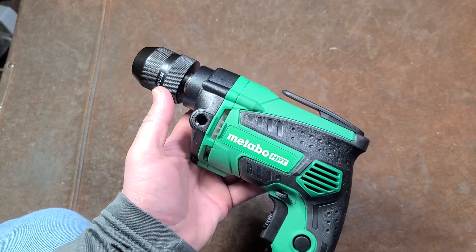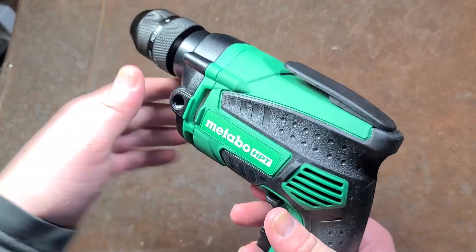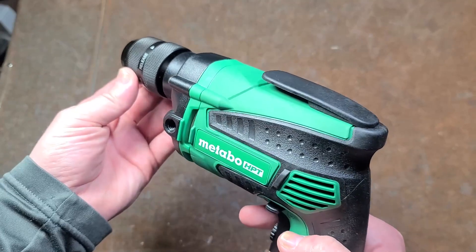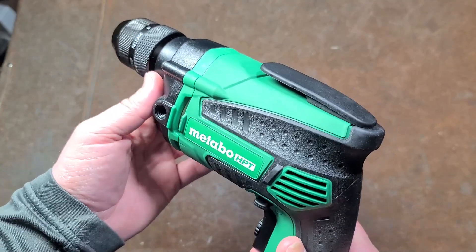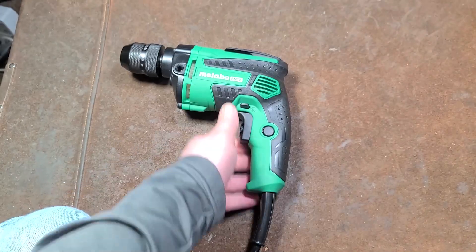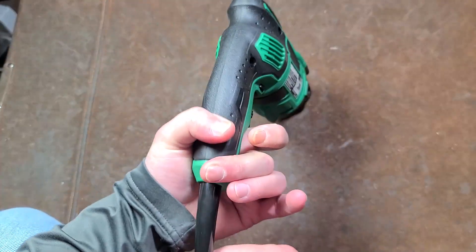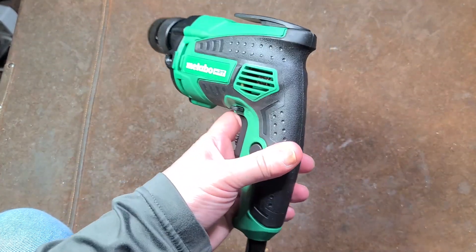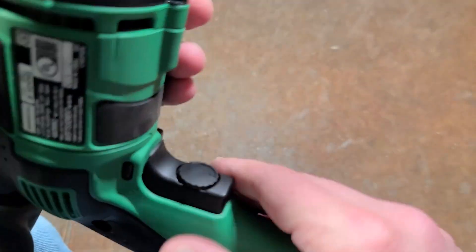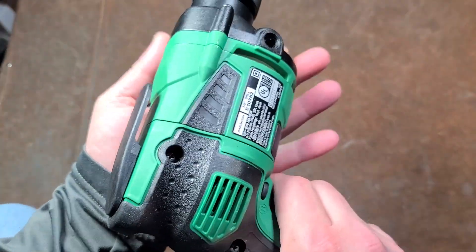It could be a good value, really — with the ball and needle bearings, besides the handles. You screw in a handle so that the vents are all nice and clear, so when you're doing long-term operations like polishing and sanding with the drill motor, it's able to keep itself cool enough. Another big complaint I've read about online is that since they've been having some assembly or manufacturing issues — issues with the wiring and connections between the power cord and the trigger switch — people have issues with it working at different angles. It does have an adjustable dial on the trigger, which I do like, but it also promotes overheating because the fans move less air.